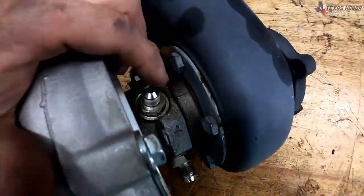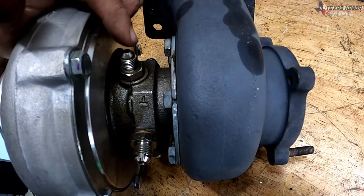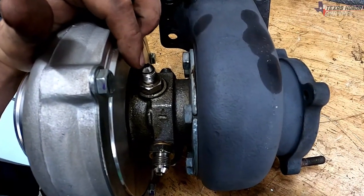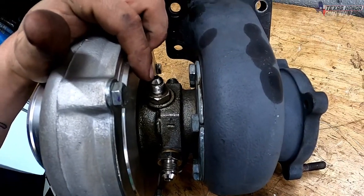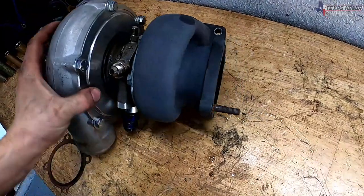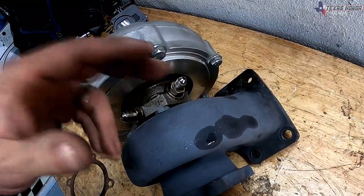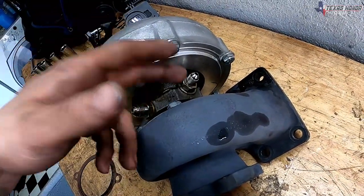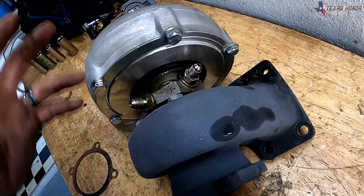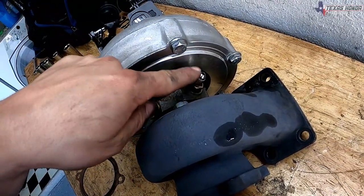This oil feed adapter, I'm going to leave a link in the description for this particular one, because it is for journal bearing turbos. You can buy these with ball bearing turbo adapter restrictor sizes, and you don't want that because it'll starve the seals for oil. So then you'll be contacting MaXpeedingRods saying their turbos are junk when it's actually a user malfunction problem, because ball bearings require less oil, so they need a smaller restrictor. Journal bearings can use more oil because they need to stay cool. But this one right here has never given me an issue, so I'm leaving the link for that in the description.